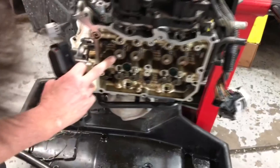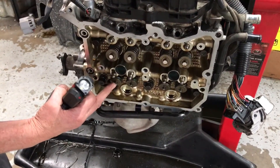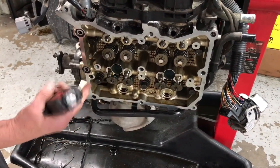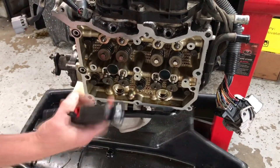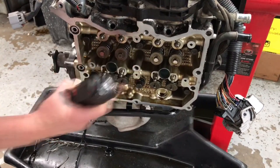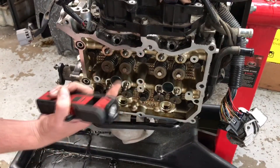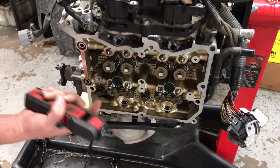Let's have a look at the engine because it is rather interesting to see how this all works. These are the tops of the valves on the inlet side, and they're the tops of the valves on the exhaust side. You'll notice on the camshaft assembly which bolts over the top it's got the roller rockers assembly, which then push on these and are actuated by the lobes on the cams to open and close the inlet and exhaust valves to make the engine run.